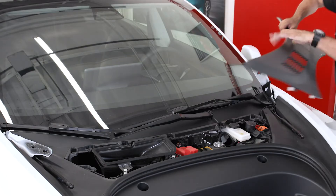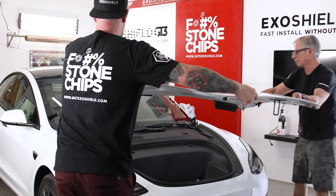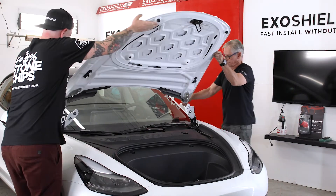That generally means the windshield wipers, sometimes the cowling, and sometimes the hood. When I put the windshield wipers back on, I always clean them and check them. It's rare, but every now and then — especially on off-road vehicles — windshield wipers could be chewed up, so you want to make note of that to discuss with the customer.